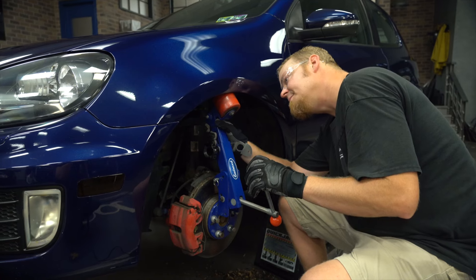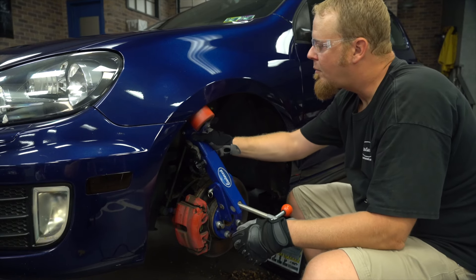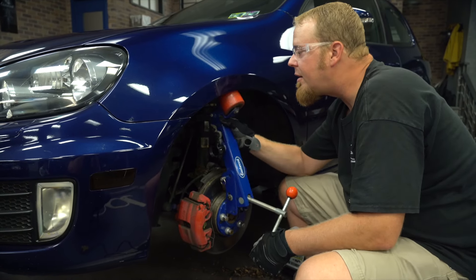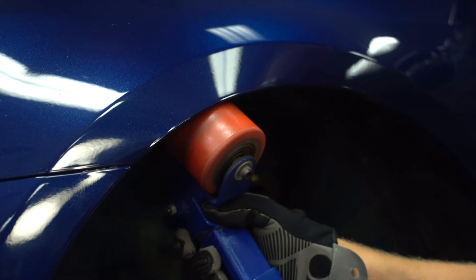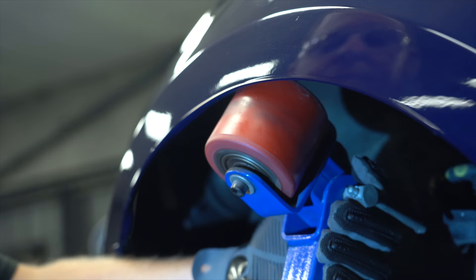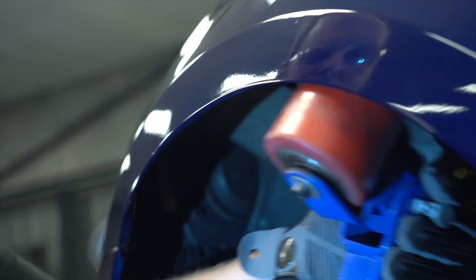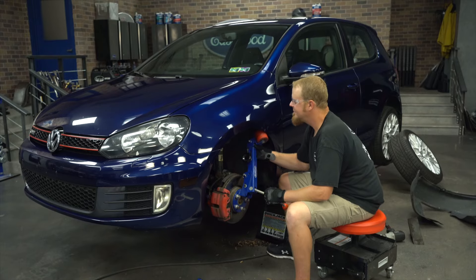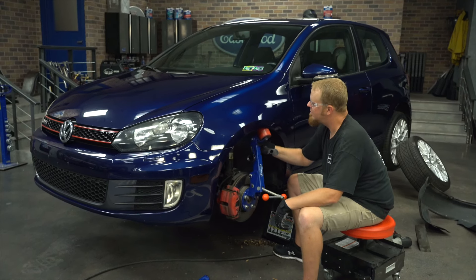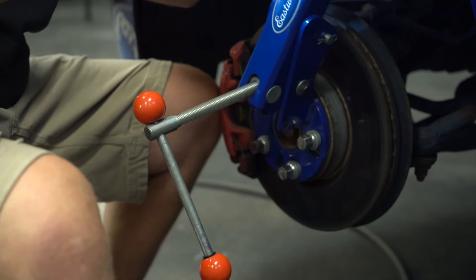The key to success here — to keep your paint intact and avoid big bulges in your fender — is to do multiple light passes. Heat your fender up, get the roller, do a light pass back and forth a couple of times, increase the pressure, go back, and do another pass. Doing it this way ensures you're not putting too much pressure on one section of the fender at a time. After just a few passes, Ryan already has that lip folded up and back just like we wanted, and the paint's not harmed in the process. As you go along, pushing that inner fender back up and in, adjust as necessary — you'll mostly be using that front roller arm to dial in a little more pressure.